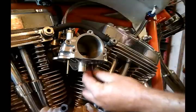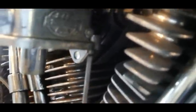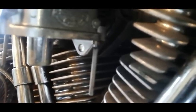This is the push rod for your accelerator pump — I'm just going to leave that in. When you turn your throttle, this push rod goes up and down and pushes down on the diaphragm in the float bowl. The reason this one is staying up nice is because the rubber boot is in good condition and sealing well. If your rubber boot is hardened or broken, you do need to replace it.